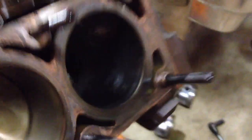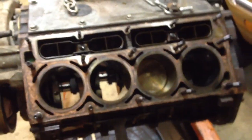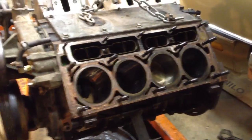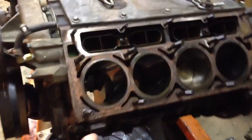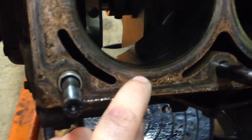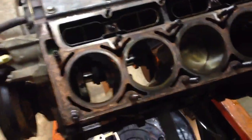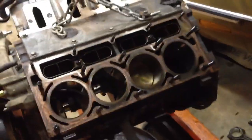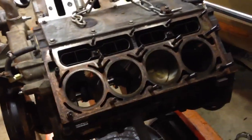The rest of the motor still looks great as always. It's still scuffed up from when I scuffed it. The head gaskets were fine — I reused the LS1 head gaskets and I'm going to reuse them again, because they're not a point of failure. Everybody says the LS9 ones are better, but how did people ever make lots of horsepower on LS1 engines before the LS9 engine came out? Also, an LS9 gasket isn't sized for a 5.3 or LS1 bore, so it's going to sit out farther and actually gives you less surface area on the gasket. I'm a practical person — I question how much better they can be just because it's more layers of steel. That's a steel gasket, the LS9's a steel gasket. I really don't see too much of a difference unless this lifts the head and someone proves me wrong.